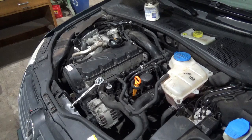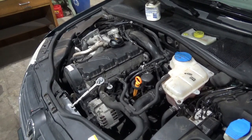That's right. It just feels... Yeah, it's 11. It's 12 inches in a foot. So 11 foot-pounds times 12 equals 132. Yeah, it's 132 inch-pounds. Or if you're using an inch-pound, it's 132.